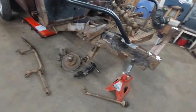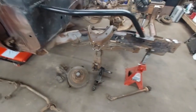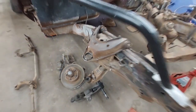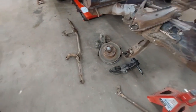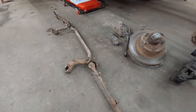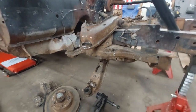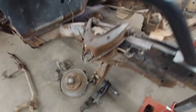My nephew came by Friday night and went to town — Wreck-It Ralph got turned loose with a hammer and a chisel, more so to break the welds holding the ball joint in on that control arm so we could take the front suspension apart. As you can see, we've got the spindle laying here, lower control arms all blown apart, drag link, tie rod ends, idler arm, pitman arm — all that's laying here. The only thing left to do is separate the control arms and drop them from the car; I've got to slide the torsion bars back to get the lowers out — not a big deal.